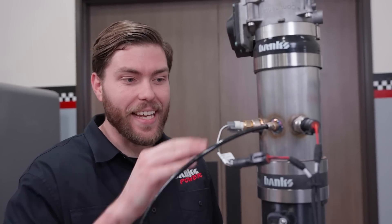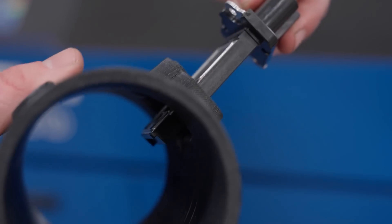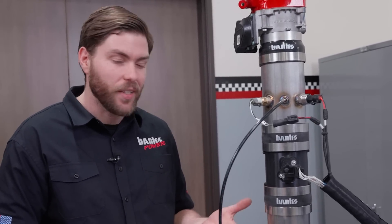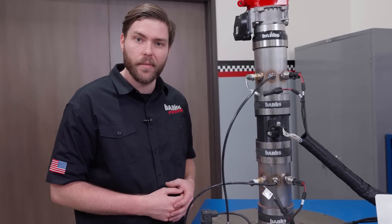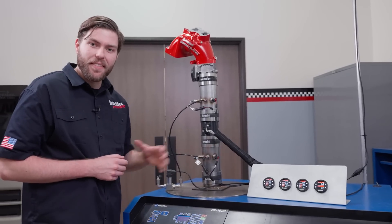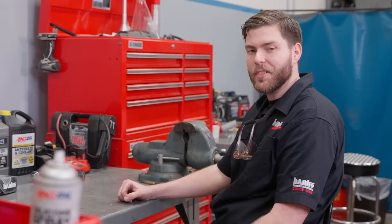We've also added a temperature and pressure sensor both before and after the MAF sensor, so we can see how the MAF sensor itself is affecting flow. In any intake, the MAF sensor sits directly within the unit, identical to how it would behave in a running vehicle. But if we test a part like an exhaust or an intercooler, we have to account for its own presence, and with this sensor suite we can get the differential of density across the sensor and factor that out in the final measurements. Our Frankenstein flow bench also monitors the ambient environment — our AirMOS portable weather station gets ambient temperature, pressure, and humidity. With four iDashes, we can see all the densities and their components in real time, though you can also use a single iDash to data log all of these sensors. The CFM-based flow bench has been obsolete for decades, but to bring it into this century, all you need is a mass airflow sensor and an iDash.